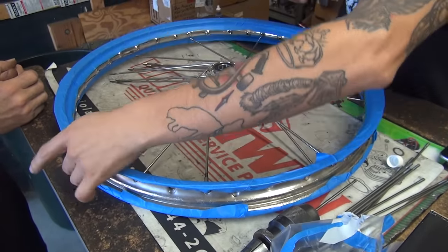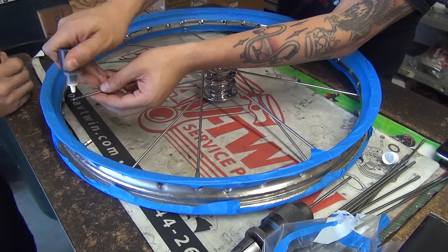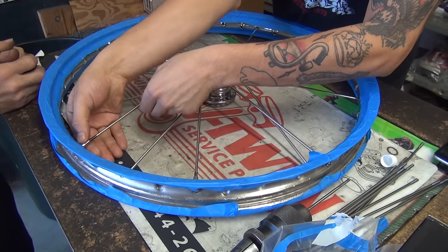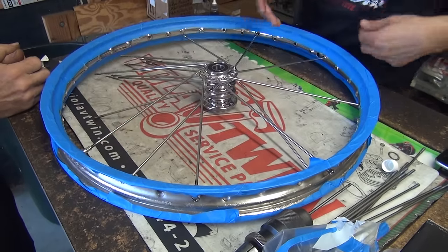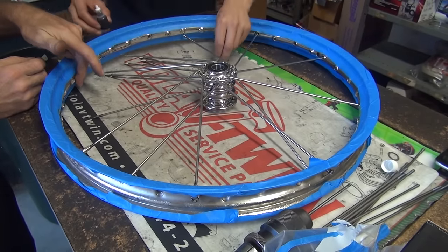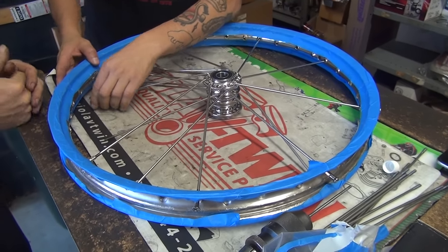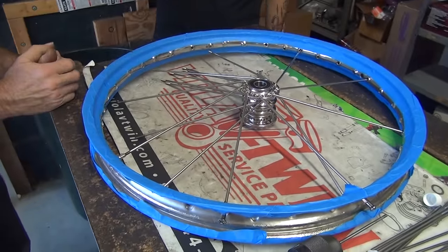Is this a drop center rim or a standard rim? That's a good question. Let me ask - is this a drop center? I don't know, I gotta go google it and see the difference. Technically a standard rim is a drop center. It is a drop center rim. But it's not considered a drop center rim. Because in 1948 through the 19-somethings, this here is a drop center but this is considered a standard. Drop center is the one that has that H pattern with the way in here. More like your 16-inch rear wheels. But they also have a flat rim which doesn't have any drop to it - no shoulders at all, it's flat. But that's not a standard rim, that's a flat rim. You got flat, standard, and drop.